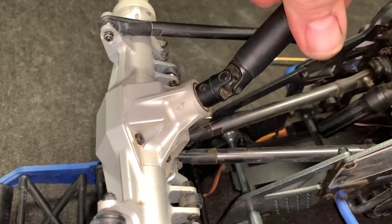So in the end, it took a little bit of shimming on the pinions to get these things to quiet down. On the back I still think I'm going to go into that one - I feel I may still need to back the ring gear off and then bring the pinion in to get that mesh right. The front actually worked out pretty good so I'm going to leave that alone. I'll get into the back a little bit but just off camera - yes, I do stuff off camera, believe it or not, I actually go drive with my buddies off camera.